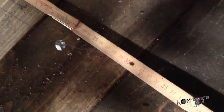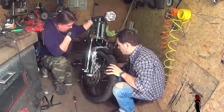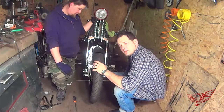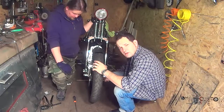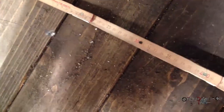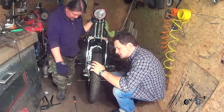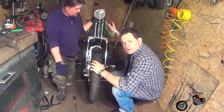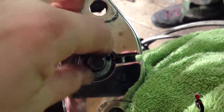What we do now is, to register the steering, you have to tighten the top neck bolt enough so that the wheel will not fall off before about 12-15 centimeters from the center. So in our case, since the center is marked by the pendulum at 30, it will have to fall at about 45 centimeters on one side and at 15 centimeters on the other side. If you're dealing with inches, you can do pretty much the same by converting the numbers of centimeters into inches. So by tightening the bolt on the top of the neck, we will make the steering harder.